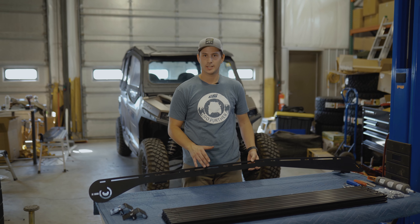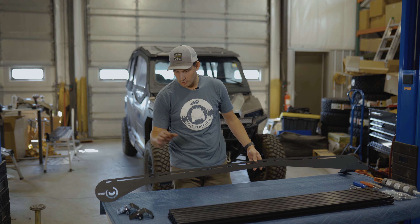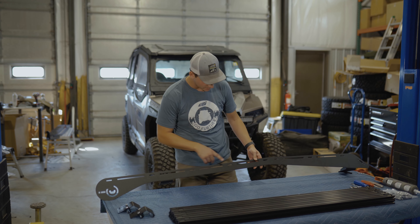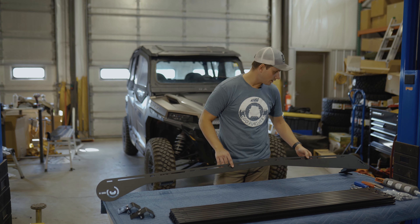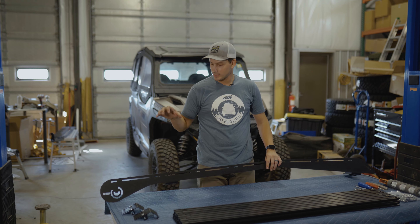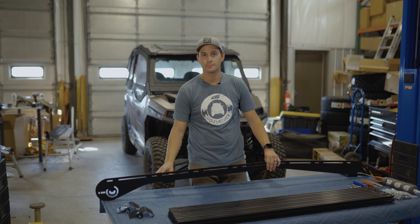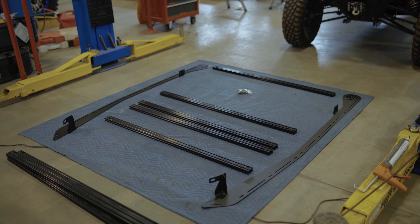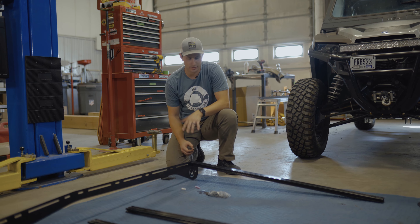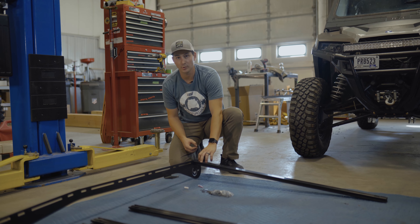With our wind deflector put together, we're ready to move on to the rack itself. We're going to take our crossbars and mount them into the smaller slots along the side rails, but we're going to avoid the slots that are near our mounting feet. The purpose behind that is when we go to install the rack, we want to have clear access to those mounting points. Also, while putting in these crossbars, make sure the mounting slots on the top side are all facing upward and in the same orientation.